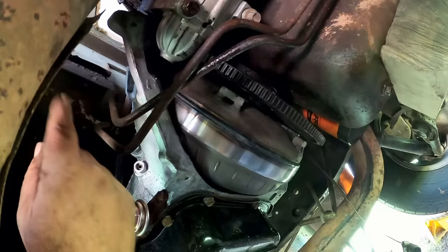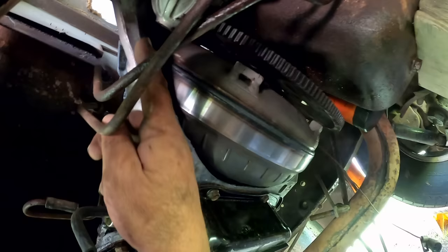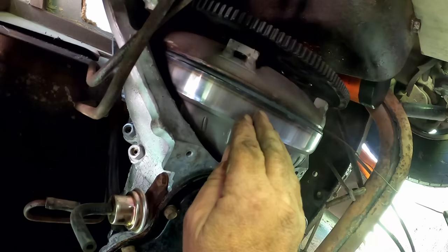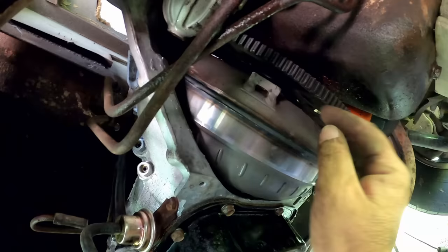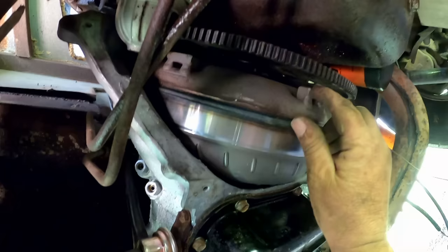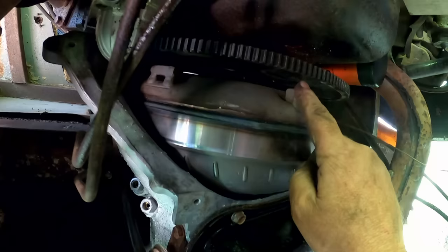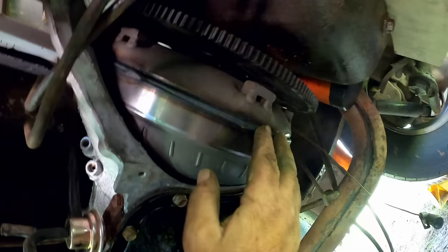And this is really an area you have to watch out for, and I think this is where my buddy went wrong that broke that bell housing: the torque converter actually wasn't in quite the whole way. It steps on, like two shafts. Anyway, it's easy to do, and I almost made that same mistake. I saw something didn't look right. There wasn't very much clearance here, and I was getting close. There was still a gap between the transmission and the engine, and almost nothing here. I'm like, that ain't right, something's wrong. I didn't get mine in all the way in either.